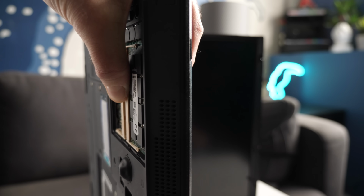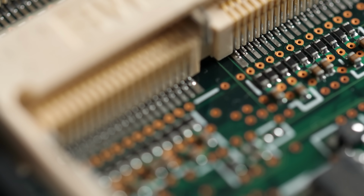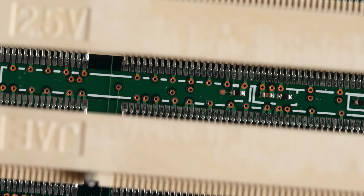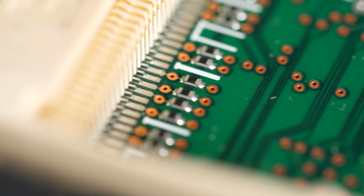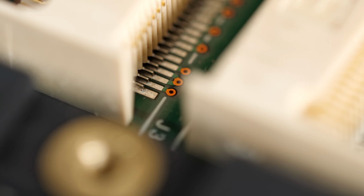As a test, I tried powering the laptop on while applying pressure to the lower RAM slot, but that made no difference. The solder legs on these are tiny, and even just one with a bad joint could be enough to keep it from working. They visually all looked okay to me, but cracks in the solder can be tiny and hard to find, so it was clear that reflowing the bottom slot was the best option.